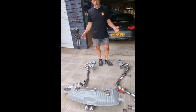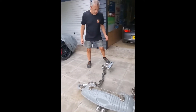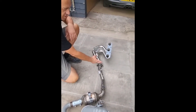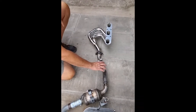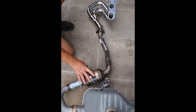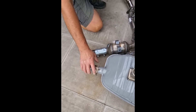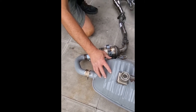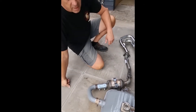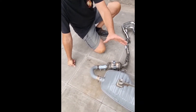We've got a complete mock-up here of a 986 exhaust as it sits on the car. Going through the components: we've got the manifold or the header, depending on your terminology. This has got a joint here which joins into the cat and the pipe of the cat. From the cat, you've got a sleeve joint which then goes into the U-bend. The U-bend is then clamped into the rear silencer — the only silencer on the system. This system is a standard 3.2 twin tailpipe, but 2.7, 2.5 — exactly the same setup.